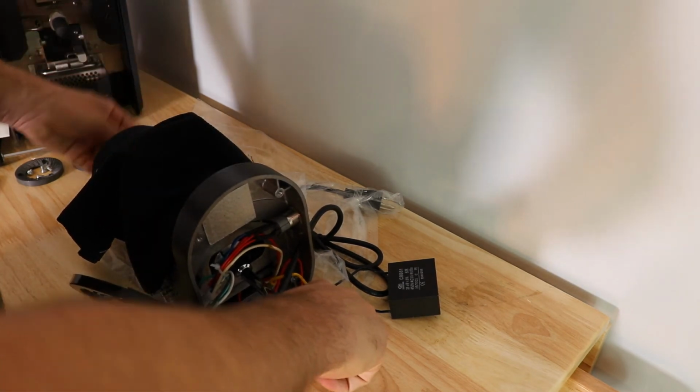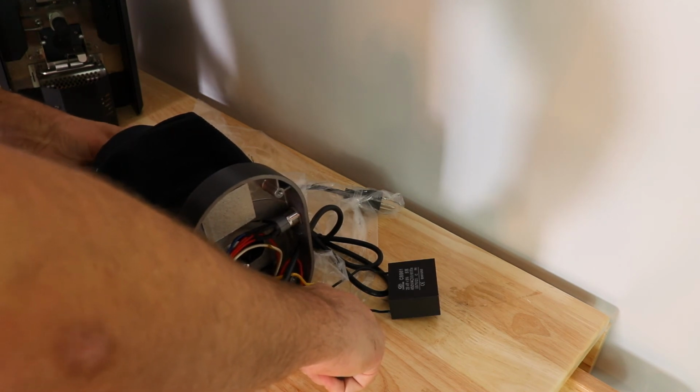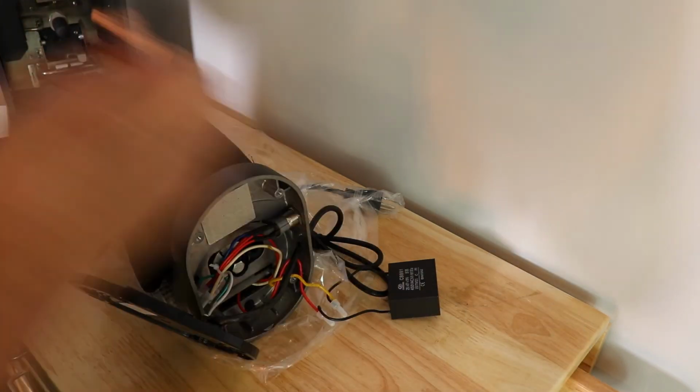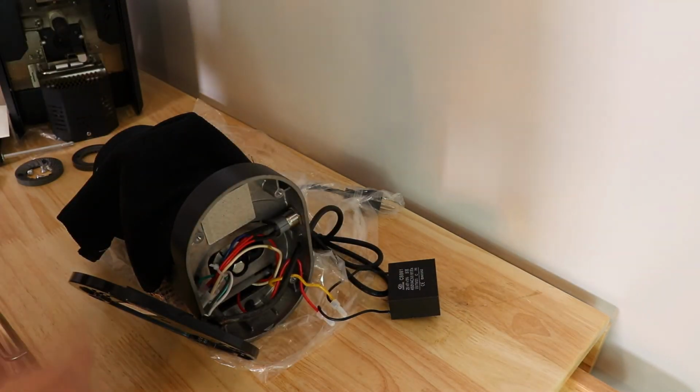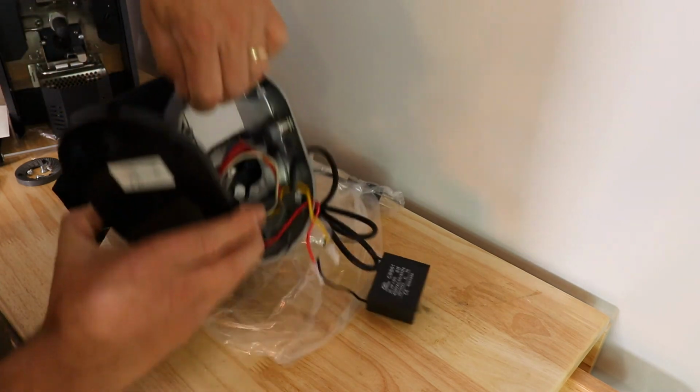And then you tighten up on it. After you tighten up on it, you want to double check that the burrs are not touching. Lever's all the way over here. We're done. That is the 0 point on this grinder, and then we just have to put it back together.